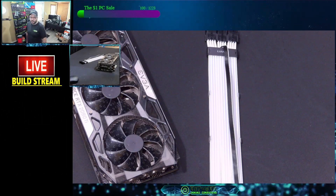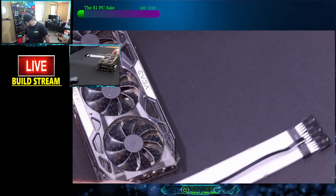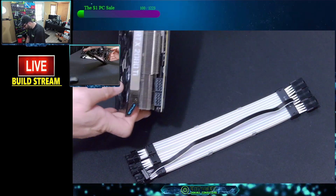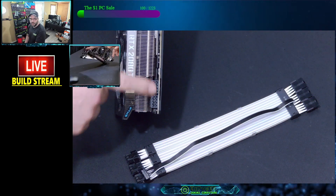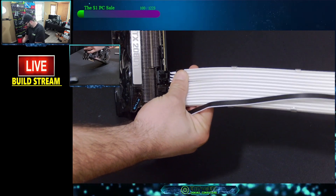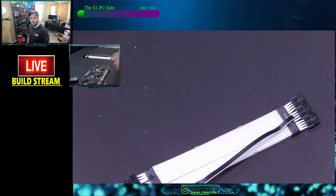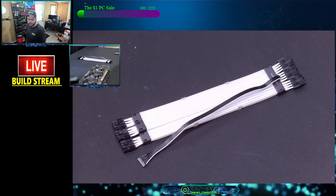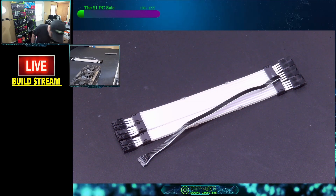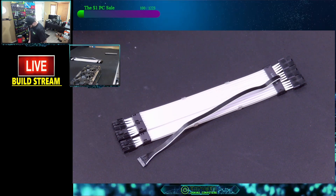Ben with Empower Gaming Computers here. The RGB Lian Li Streamers — this has been a common question that I see a lot. It's in the event that your card is the opposite direction or your PCIe pins are flipped around the opposite direction. So when you pull your streamers out of your box and go to plug them in, they're actually the wrong way — your RGB is on the inside, not the outside. Just wanted to show you how to flip the RGB around on the Lian Li Streamers. This is actually not a very difficult task, though most of the time it can be a bit of a pain. Let's get started.